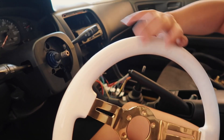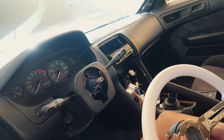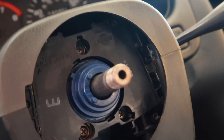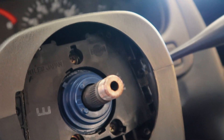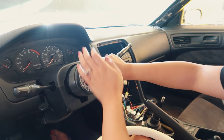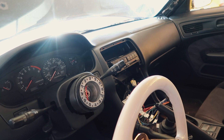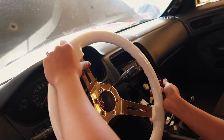Figure out which hole matches up with the hub — there are two sets of holes. Typically you want the car wheels straight when you install the steering wheel; we'll roll the car to adjust later. There's a line on top of the steering shaft indicating top dead center. I had to turn the wheel to lock it, so that's likely your top dead center. Put the bolt on just so it doesn't move, tighten it down, then bolt the steering wheel to the hub and leave the horn out so we can still adjust for center.